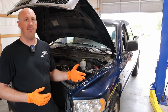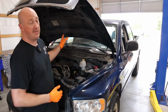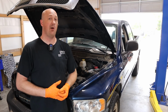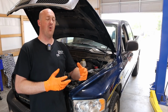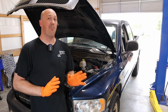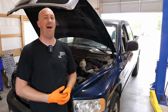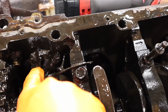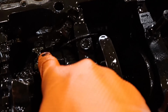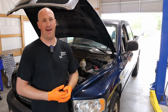Yesterday when I got it all fired up there, I mentioned that there was going to be some smoke out of the exhaust, and with that smoke that was pumping out of there, honestly, I started to get a little bit concerned, because I was expecting some smoke from the oil in the cylinders, but it was puffing out pretty good and it was lasting for a while. But then I remembered what happened to the previous engine, and I realized what had happened, because when it broke through the cylinder wall into the water jacket, it dumped a ton of coolant into the exhaust. So there was a bunch of coolant in the muffler area, and basically it just had to burn all of that out of the system.